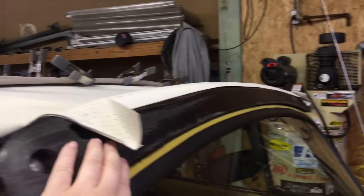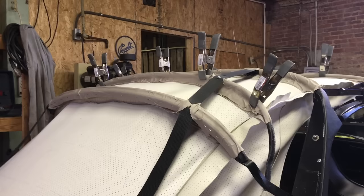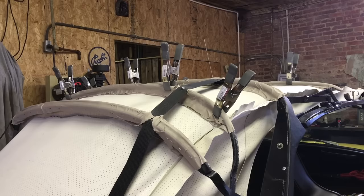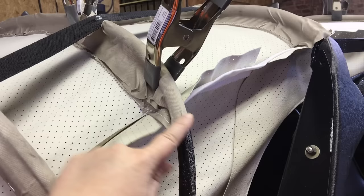This front bow just has the top — we haven't wrapped anything else around it yet. But each of the metal bows and other wood bows on top of the frame have now been wrapped. After wrapping each bow with listing fabric and clamping as they dried, we trimmed any excess listing fabric that was hanging down or lying over the headliner.